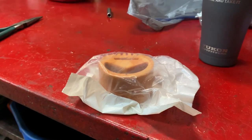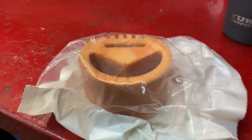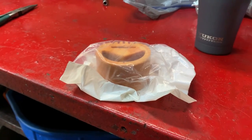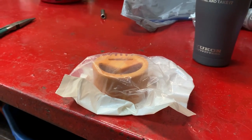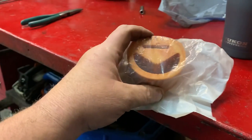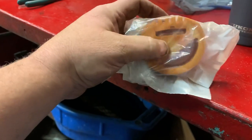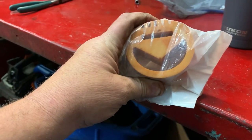A lot of technicians won't even know that this is there, because 90% of the time this foam rubber snubber is completely missing. When you go to work on a golf cart you may not even notice it being gone because it just rots away. They make better ones than the foam ones — they make some out of urethane that last forever. This one is an updated version of the foam one; it's not the urethane one, but it still lasts a lot longer than it used to.